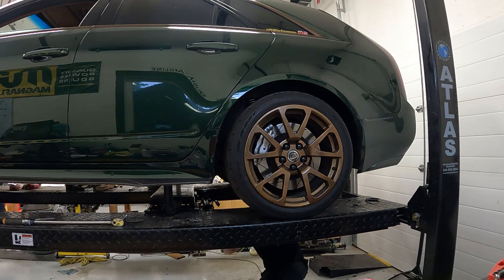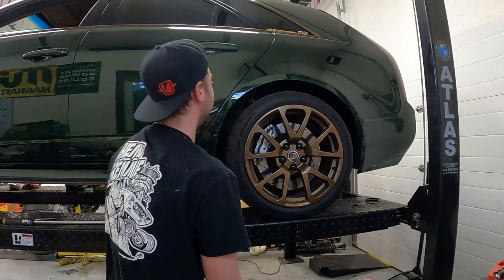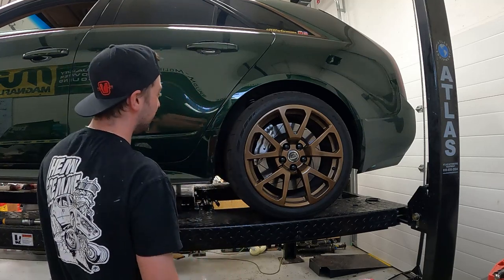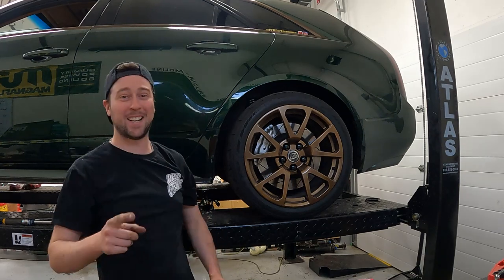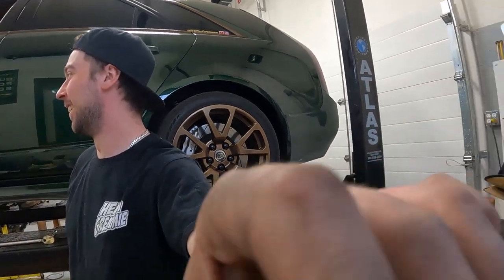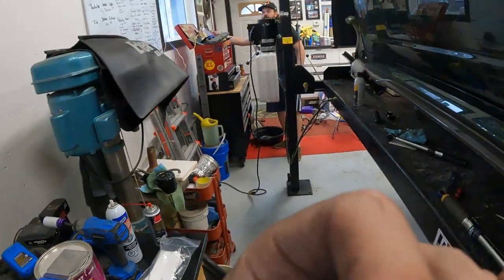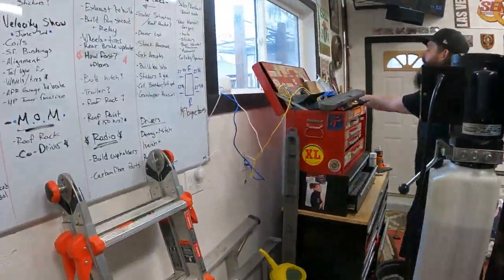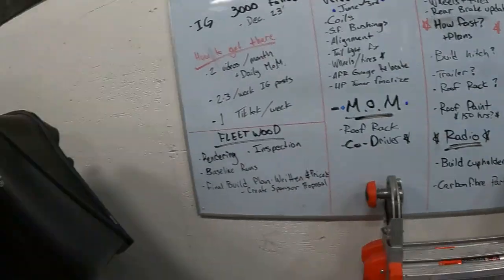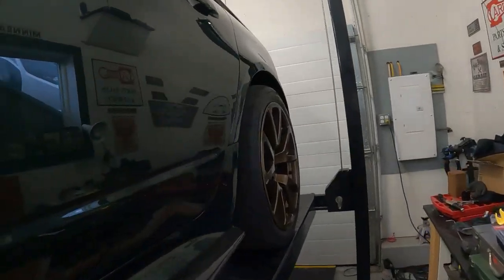down! Is it monster truck or low? No. It is monster truck. Off-road capable. Okay. We need to adjust the coils. Just for the sake of it, you should measure it to the fender lip. Yeah, absolutely. You got your tape? What was it before? 27 and a quarter-ish? Maybe 3/8.